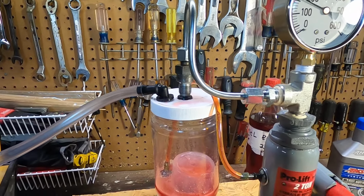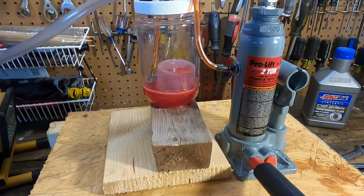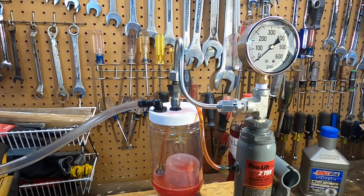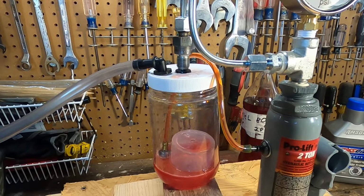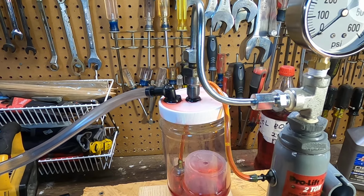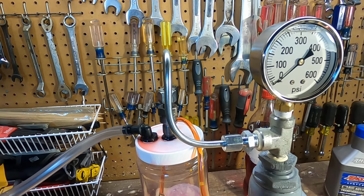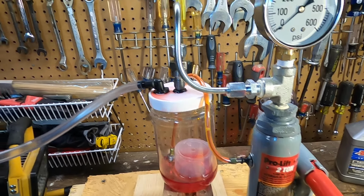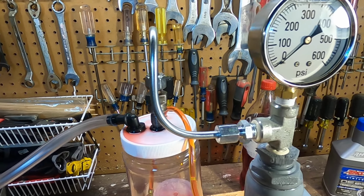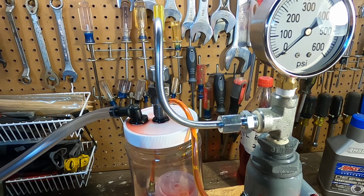Alright, let's release the pressure on this. And this is a nice little setup I got from Mercedes Source. Okay, let's just undo all this. Here's the third. I know these mechanical fuel injectors are still available, but given their price, $120 a piece for the Bosch, and twice that for the genuine Mercedes, these are worth trying to clean up, those two. So let's just see what this does.